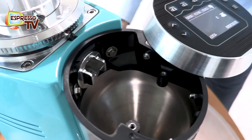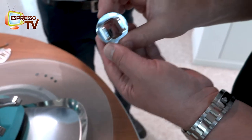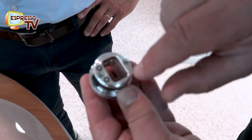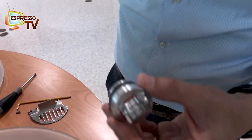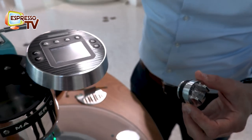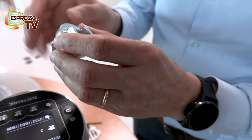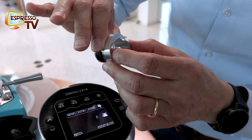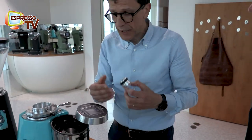Normally it could be like this, and to remove it you just turn here and that's it. Here it's written 'up' so everybody knows. This wire inside - this damper has the function not to stop the coffee, but to follow the natural flow of the grinds when they leave the burrs. This follows the flow without stopping, always following without closing the way out to the grinds, following the natural flow of the grinds into the portafilter. It's very flexible, which helps to increase dose consistency, reduce clumping, and reduce static.